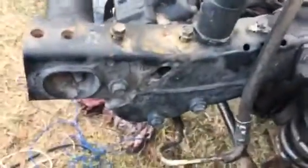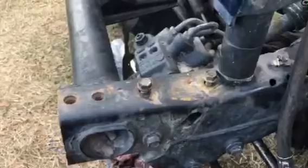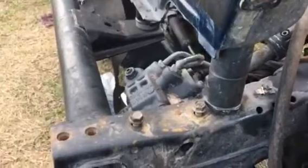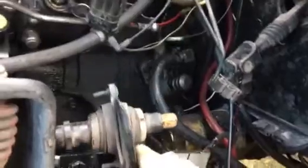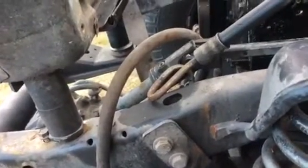So what I'm gonna have to do, you know, I could always cut it out and put one of the Durangos or the Astrovans in, but I already have a ram, an 8-inch stroke ram, and an orbital valve I got from work that I might just go ahead and plug in. Like this could work. I had unbolted it for my mounts, but I could make something work there. I don't know. I doubt that that'll have enough strength to move all this weight, especially with 42s. We'll see though.